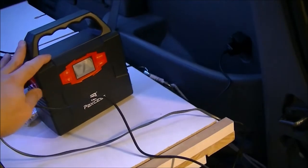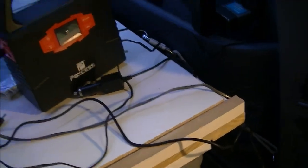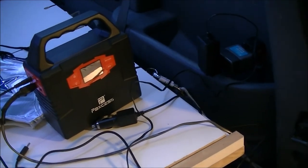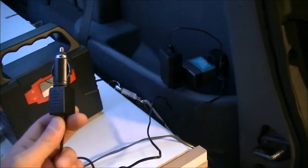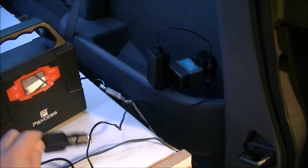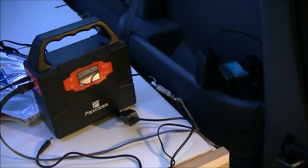With a 12-volt battery in a car, it's sometimes hard to get a high enough voltage to fully charge a 12-volt battery. So I also have a small basic inverter — plug that in and I can charge it with AC power. That charges these batteries a lot better, because the car's 12-volt system sometimes only goes up to maybe 12.5 or 13 volts, which just isn't high enough. Using even a small inverter gives you much better charging performance with these small lithium-ion batteries.